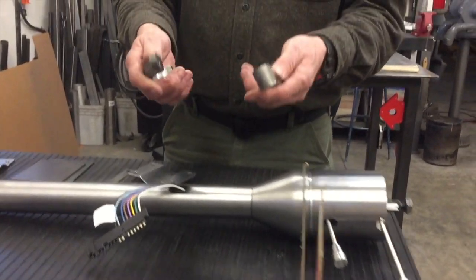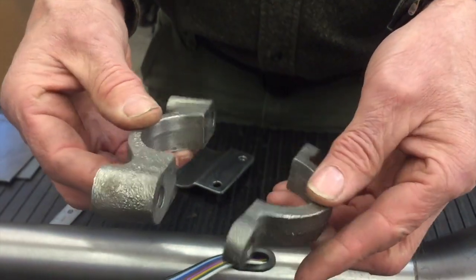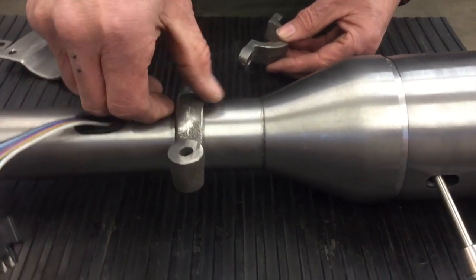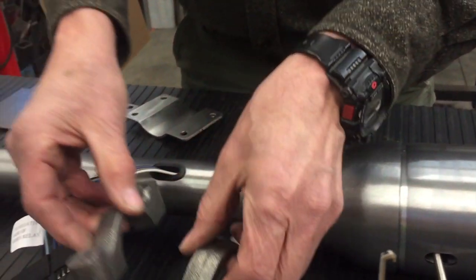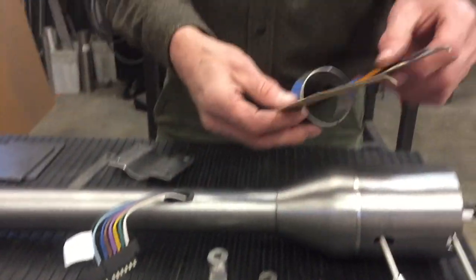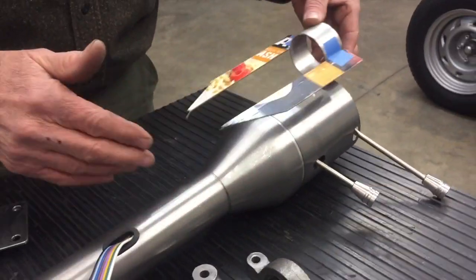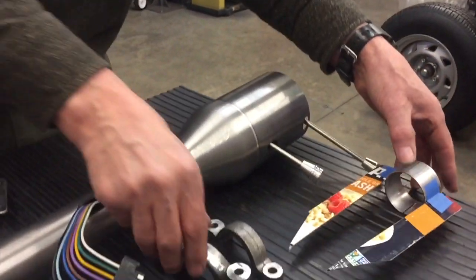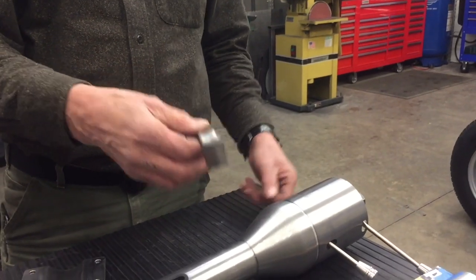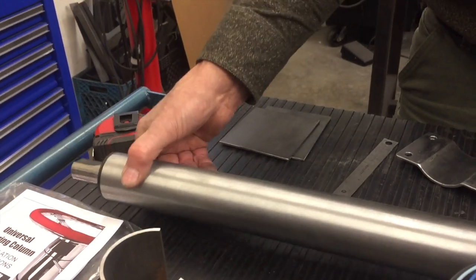These are the factory brackets for the column. I like them — they look good and they work fine. They fit the column perfectly; they're exactly fit a two-inch column, which is what this is. When I first installed these, I had a little jig that I made to simulate the width of this, and I actually got it pretty close. But when I put this column in and mounted these to the dash in the original factory location, they hit here and wouldn't allow the column to go through the floor — it was just kind of hanging loose.